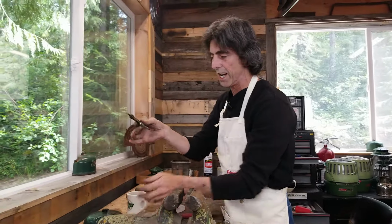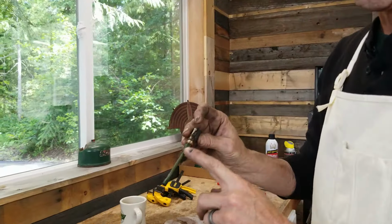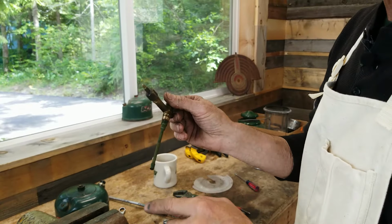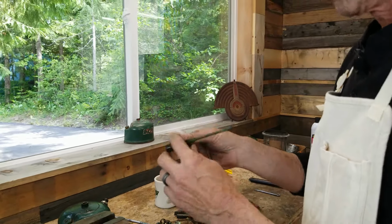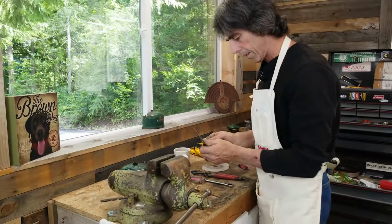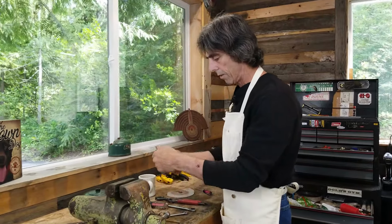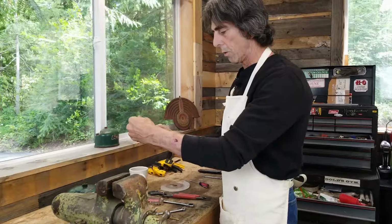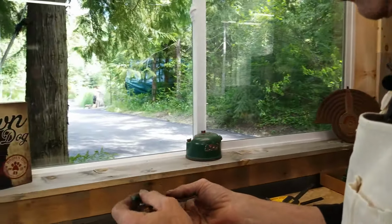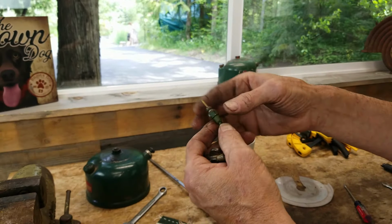You can see it's green. That's the fuel and air tube. And it's green, which means it definitely needs to be cleaned. It smells horrible. There's a lot of varnish in this. So what I'm going to do is put my 3/8 inch on there and remove it. Now there is a metering rod and a spring inside of here. It's not spring loaded, so it won't come apart, but just so you know, that's what it looks like. So you can take these pieces and just set them aside.